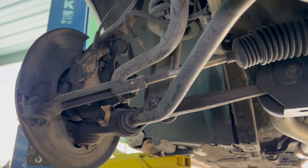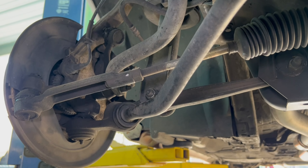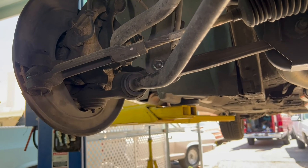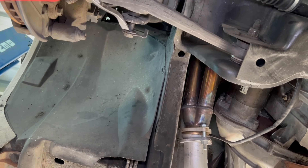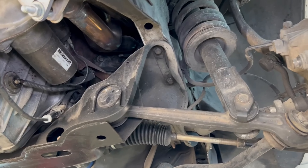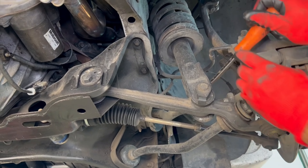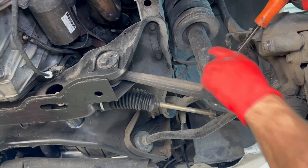We're going to start with the lower shock mounts. Got a 21 millimeter extension — we're going to run it right under the tie rod end. The bolt comes off. I've got a little pry bar — going to pop it up. Coming in from this side, the shock wants to push down so it kind of pinches this bolt, making it a little hard to get off. So I'm just using a little pry bar, coming in under here, just lift a little on the shock — just a little bit of tension — and then you can just wiggle that bolt out.